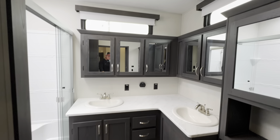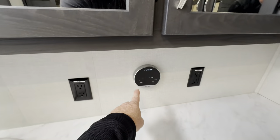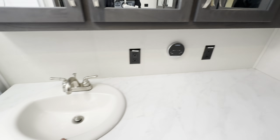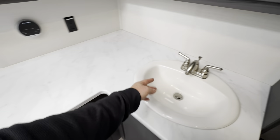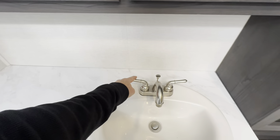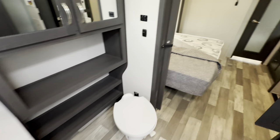On board the coach, you have a tankless water heater — I believe it's 60,000 BTU. Those controls are located here in the master bathroom. For example, if you want only 110 degrees out of your hot water, set that temperature and then only turn on the hot. Don't try to combat it back and forth between hot and cold.